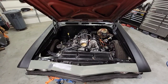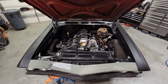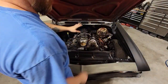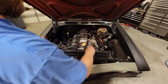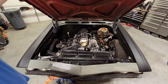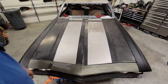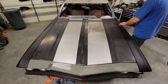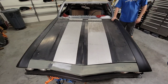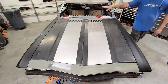Hey, welcome back. Whilst you were away, phone died, so I didn't get what I was doing. But I got this here adjusted - dropped, lifted the hood up, which dropped the hinges back on the back bolts, tightened those down. And I lifted the hood up, which dropped the front of the hinges up, and I tightened those down, just because I needed more of that down that way. So that put me pretty close on the back side there. I can adjust on this one a little bit - that's close. Very close. I feel like we're on to something there.